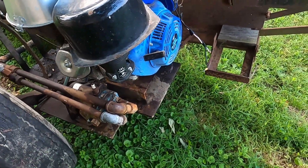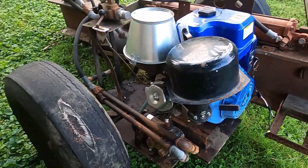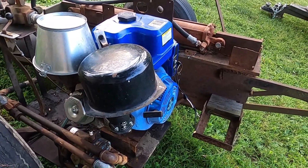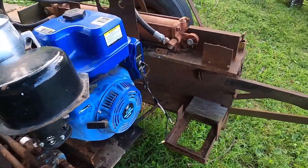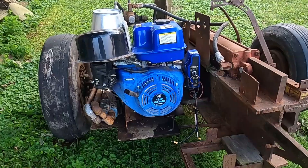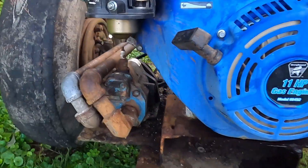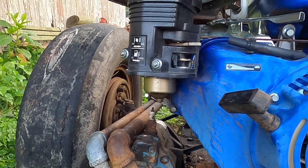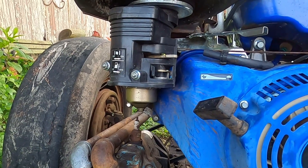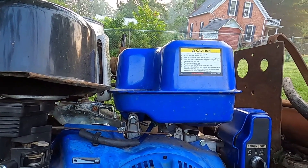Got the crankcase emptied out, what we thought was dried out, and then got the cylinder somewhat cleaned out. Finally able to get the engine to start rolling over, and it's like — you know what, as little effort as possible is going to be put into it. Dropped the fuel bowl; surprisingly, even though there was water in the carburetor, it was not all oxidized. Got that cleaned up pretty quick, threw it back together, just a little bit of sediment in the gas tank, so cleaned that out.